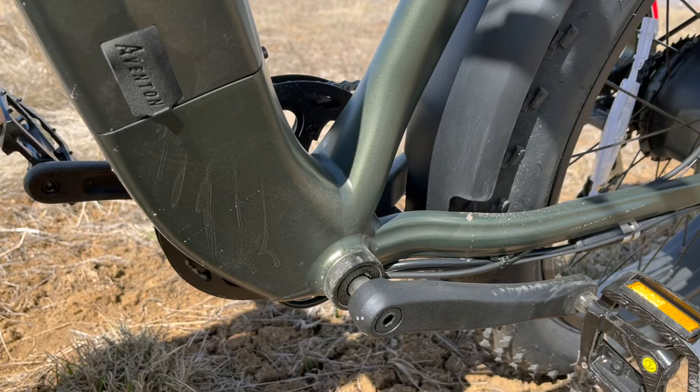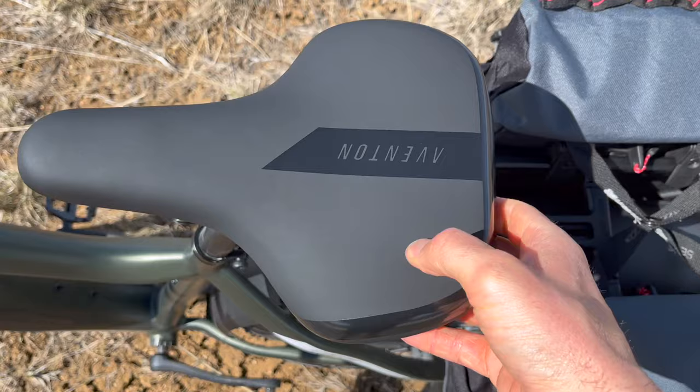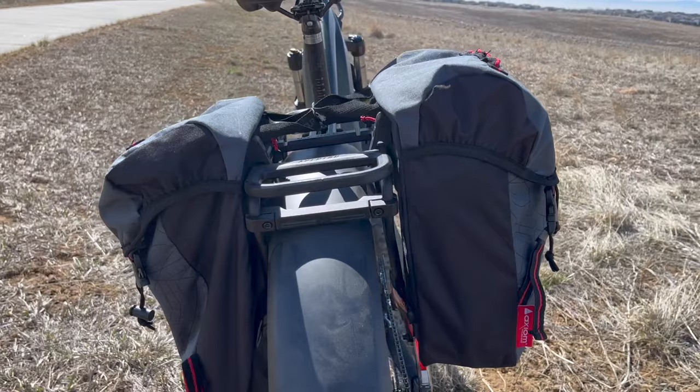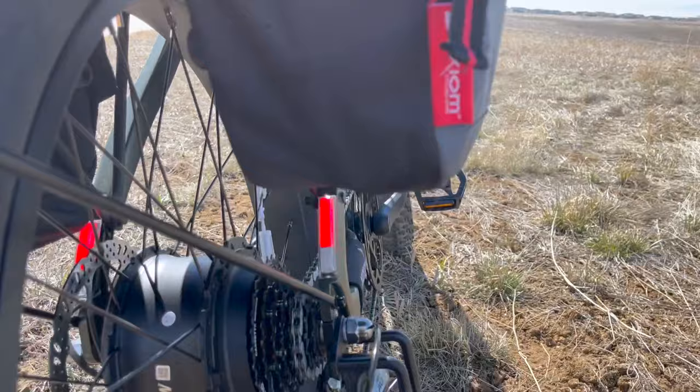The crankset is really good. The best part is the torque sensor — you have instant power as soon as you push down on the pedal, versus a cadence sensor. The seat is a standard Aventon seat they've been using for several years, nothing special there. This is a new rear rack which I really liked — a little different to install, but once it's on, it seems very solid. As I pointed out, the rear tail lights are kind of tucked behind the rack. I have two bags on it — I'll put a link in the description — and they're kind of tucked back under there.